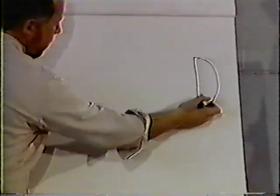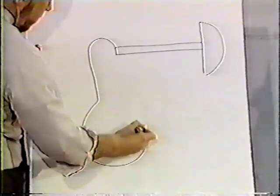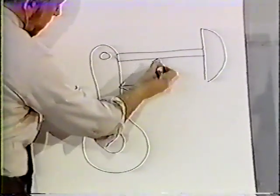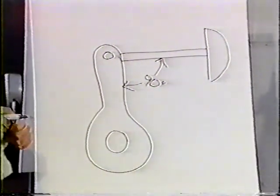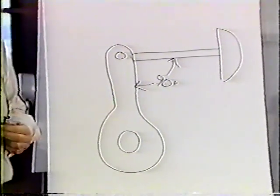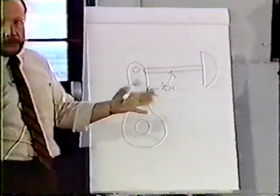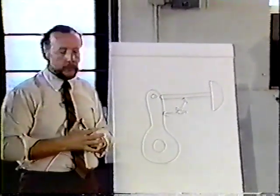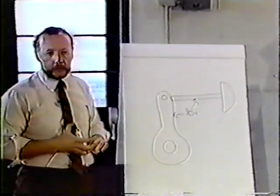We've got a certain angle we have to worry about. Our chamber and our push rod, and here we've got our slack adjuster. We want to get a 90 degree angle at 1/2 maximum stroke. Now when you put another chamber on, you're going to get a push rod and it's going to be very long and you're going to cut that down. People usually cut that the same length as the one they're taking off. Probably be a better idea to consider this angle. We want 90 degrees at 1/2 maximum stroke.